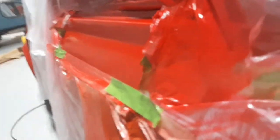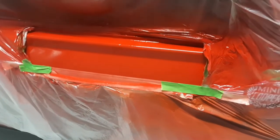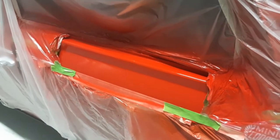Here we are back — I've got the final coat of lacquer on, about two and a half coats, and it came out very good. I'm really happy with that. In here it's going to be covered anyway so you won't quite see this one. You can see the imperfections where the rust was — you could have got that perfect with filler, but I didn't want to add more time or work. I'm going to let the lacquer dry for another five minutes, pull off the tape, and show you the finished product. If there are any imperfections you can let it dry a few days and polish them out.